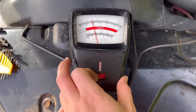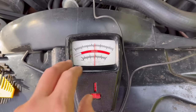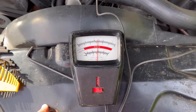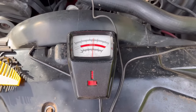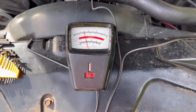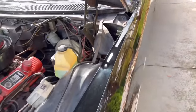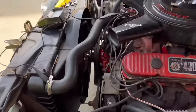I'm a little bit over 30, but close enough. There's also a tach setting on the meter. The car's on fast idle, but you can check to make sure your engine idle RPM are in the right spot. You always want to set the dwell first before you set the timing.